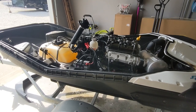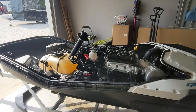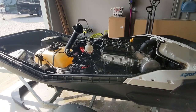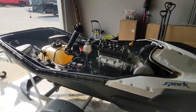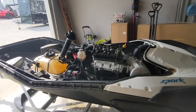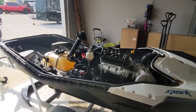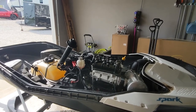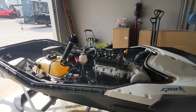I'm not really sure what else it could be. Even if it was bad fuel you'd still think it would pull out of it and run better than that. The fuel doesn't smell bad, so we're gonna fire it up and see if it idles out smooth and runs good again. This machine only has like 50 hours on it so I wouldn't think it'd be anything more than that. If you ever have a really rough idle, even when it warmed up it still didn't idle great, and it just wouldn't take off and run the way it was supposed to — might try it on your Sea-Doo Spark.